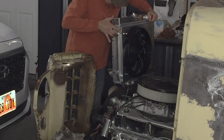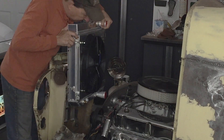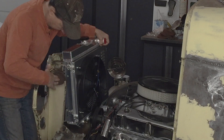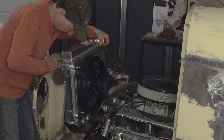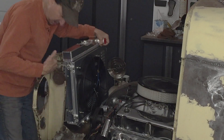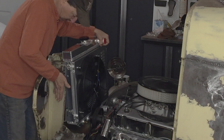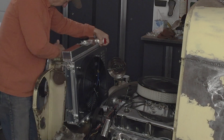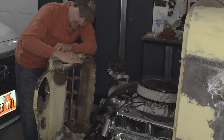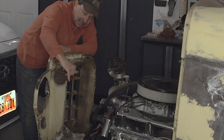Let's see if I can daintily get this in place without making any damage. So it appears that, like I suspected, I'm going to have to cut it off as far as possible and bring this all the way up to the grill area. So these flanges will have to go, and then this area is pretty beat up already from when they heated this up, bent it under, and then cut it off with a torch.